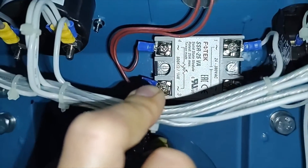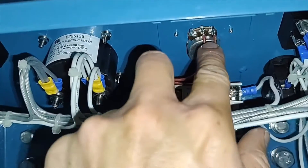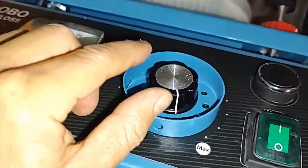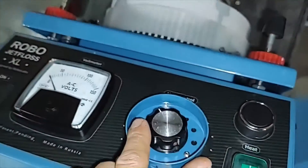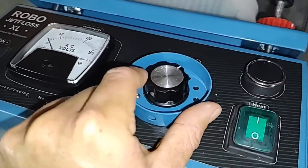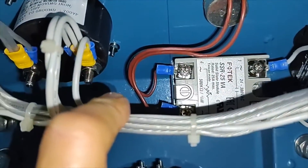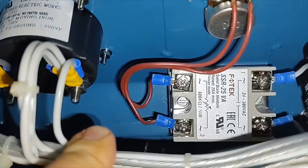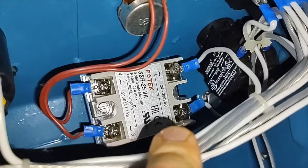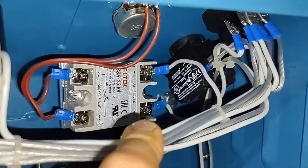The number 4 and number 3 are the low voltage wires, and they go to the brown wires. This is the variable resistor — the element which allows you to adjust the voltage. The brown wires to the variable resistor go to number 4 and number 3, and number 1 and number 2 go to the regular 110V wires, which are silver, sometimes blue and white.